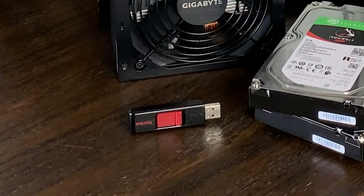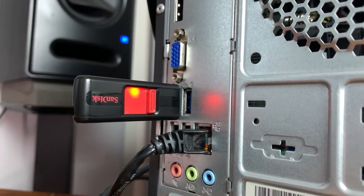This video is going to take place in a few parts. First, I'm going to take that NAS and take it outside and dust it out a little bit because it's gotten dusty just running for the past few months. Then I'm going to replace the boot drive, because currently it's just using a USB flash drive for the boot, which probably isn't a big deal but while I'm doing this I might as well replace it with an SSD.